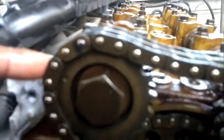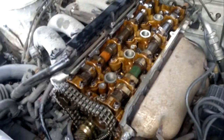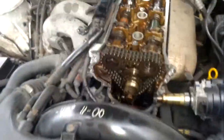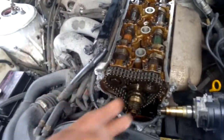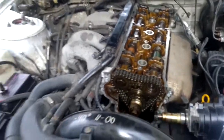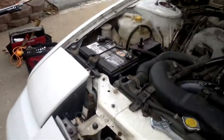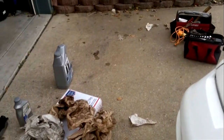That's what I did, and hopefully I did it right. So, 248-232 cam swap — pretty much the same thing you would follow on an S14, except you would already have a 232 on the exhaust side, so all you're changing is the intake. You wouldn't have to move things around. Let's see how this goes — I haven't been this nervous lately. It's my first time doing it.